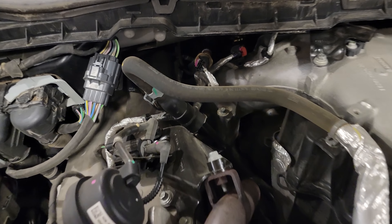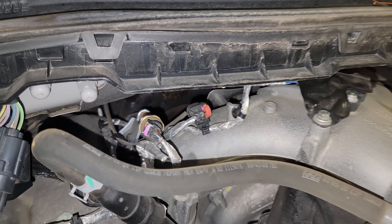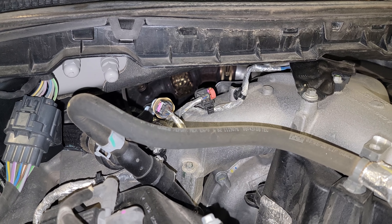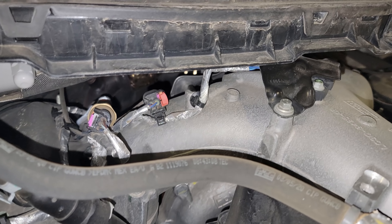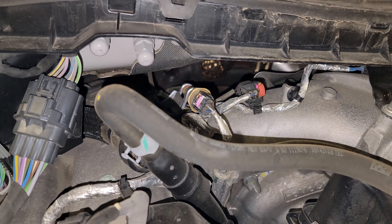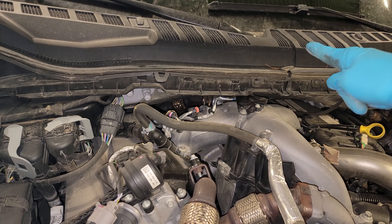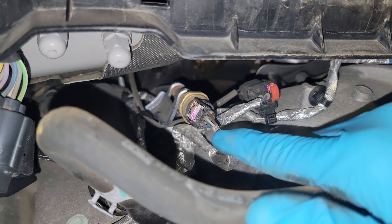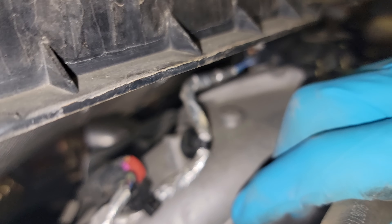When repairing these things, you guys need to pay attention. I want to zoom in, get close, and hone in. There are three very important sensors on diesels — all Power Strokes. Our pressure sensors are huge: exhaust back pressure (EBP), manifold absolute pressure (MAP), and barometric (BARO). Sometimes BARO is integrated into the mass air flow sensor on 6.0 liters, or there's a little box underneath the dash, sometimes in the computer.